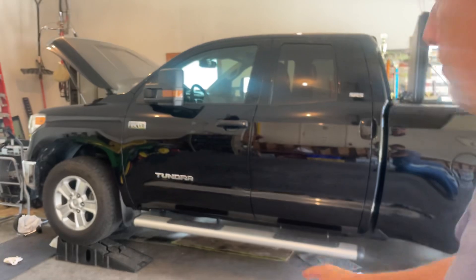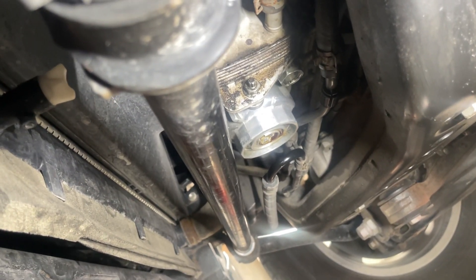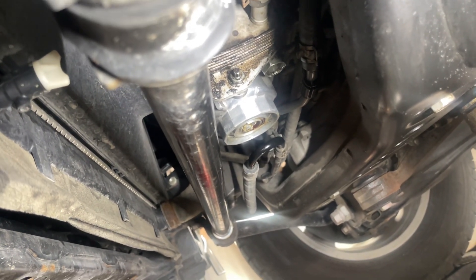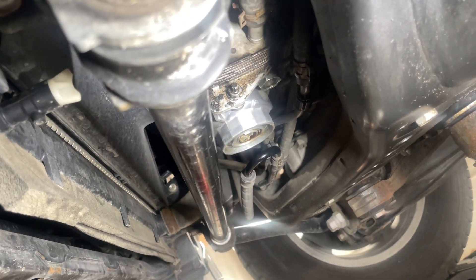Here I have a 2014 Tundra. It runs great but I had some problems with the canister oil filter. The first one was plastic and it eventually cracked. I replaced it with an aluminum one and I just recently had another problem. I've got approximately 75,000 miles on my 2014 Tundra and I don't drive it a lot. I'll show you some things about it.